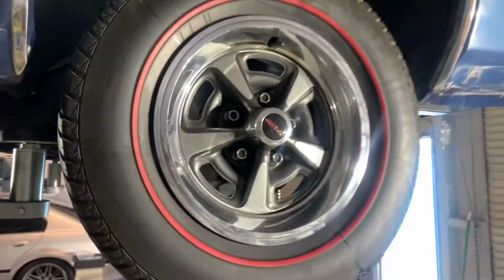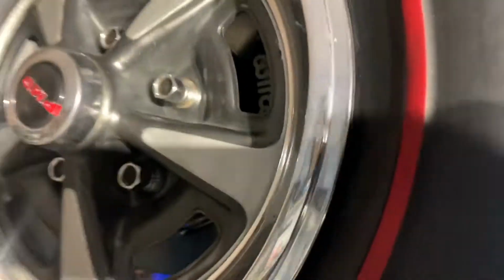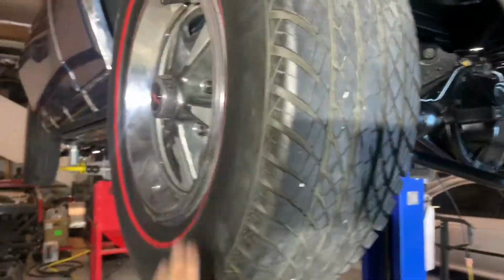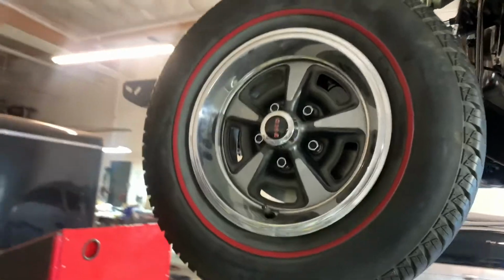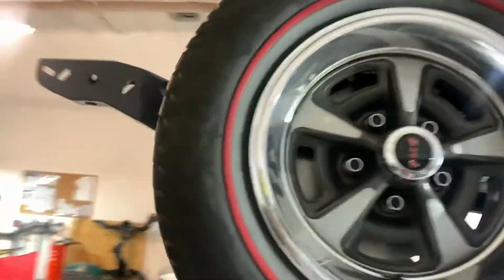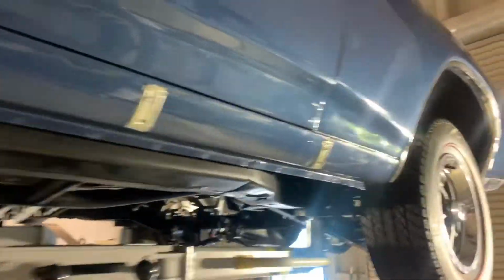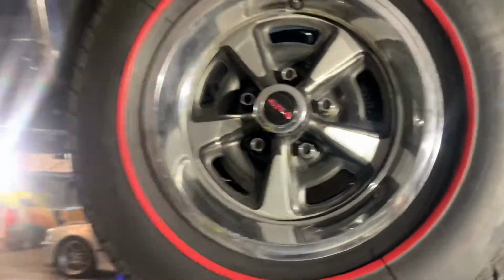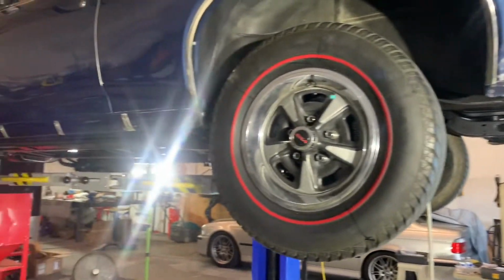Wick and I were just talking about tires. His wheels have been built by Wheel Vintiques. He's getting 15s. We're debating between a 275/60 and a 295/55 15 at the back. We're talking 235s up front. I'm trying to talk him into maybe a 255 because mechanical grip is key, boys and girls. And it's not like these cars have any aero help, so it's all about suspension and actual rubber touching the road. Mechanical grip will be your friend.